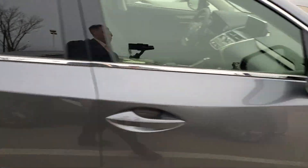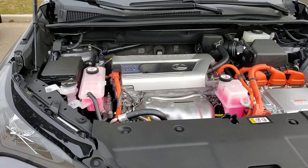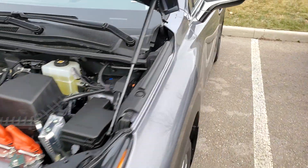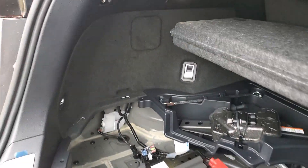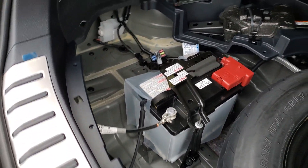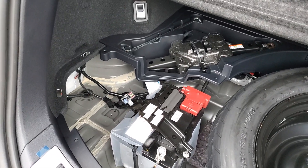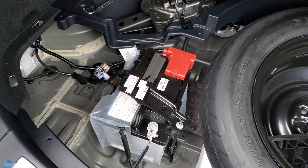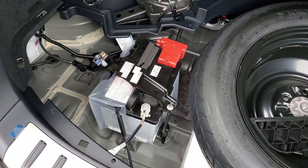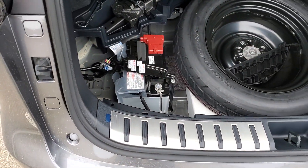As you can see in the front, unlike a conventional gas engine where you have the starter battery that actually starts the vehicle, on a hybrid system you're going to have that in the back just underneath here. It still does have a normal battery that starts the car — relatively cheap, just like any other one. You might have to replace it every five or six years depending on how much driving you do. That one is strictly for starting the car and turning lights on, not for actually driving it.